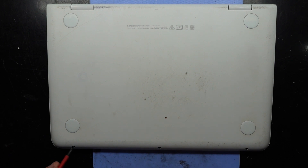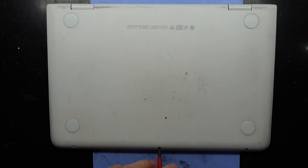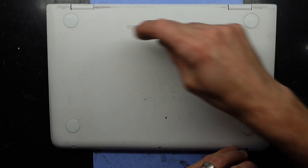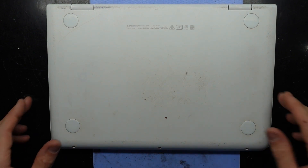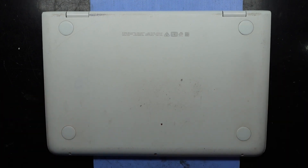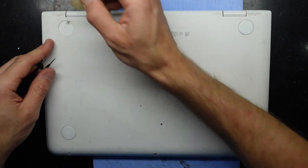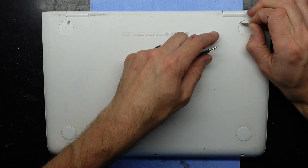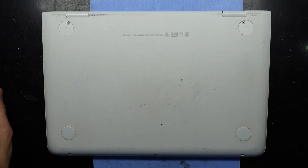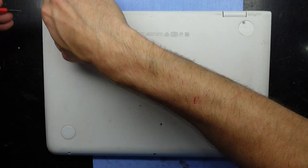To begin with we're going to need a Phillips head screwdriver. Take out three screws along the front here — all three of these should be the same. Then I believe we're going to have to take off two of the feet to get the bottom cover off. I'm not expecting upgrades on this smaller budget machine. Use a pair of tweezers, just slide under and lift up. We have one screw under here and probably one screw under here as well. I don't expect any under here, just due to the overall size of this particular cover.